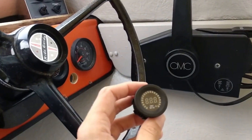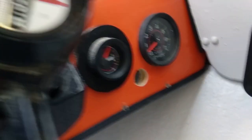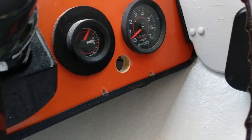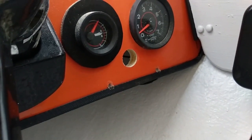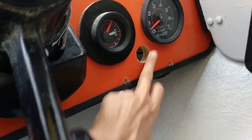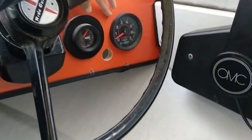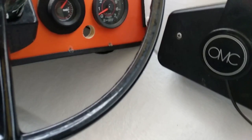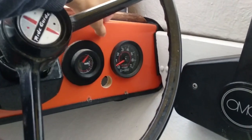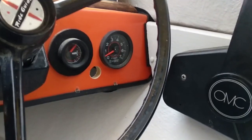What I've done is already drill a hole in the fiberglass — a 32mm hole using a spade drill bit. That went through really nice and cleanly. There's a bit of a white mark there but that's just dust. I needed to pick an area; I considered putting it up the top here, but there's quite a lot of thickness to get through up there, so I decided the bottom of the dash is the best spot.